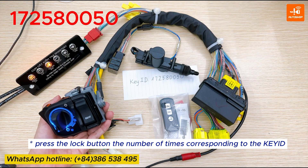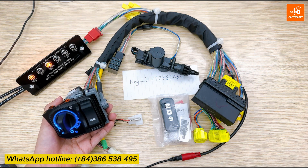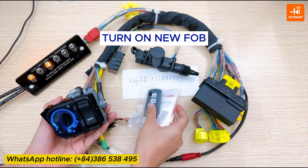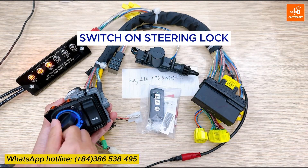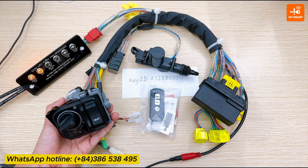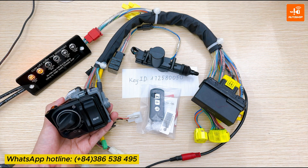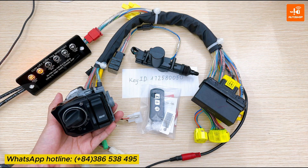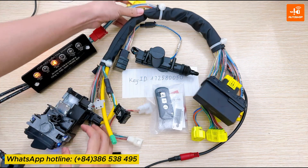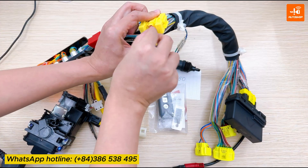Finished. Turn on the new FOB. Switch on the steering lock. You can see that the light on the steering lock and the smartkey light flashed 4 times. It means that the new FOB has been registered with SCU. When finished, unplug the fuse.